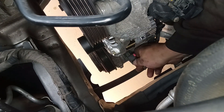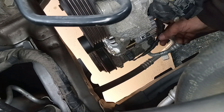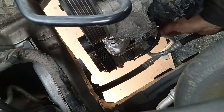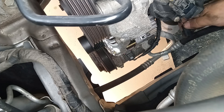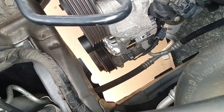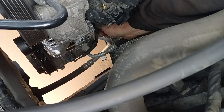Then we'll just put the belt back on. While I'm up here, why not put all the connectors on? Here's the AC one — put that on right quick, just like that, push that over. We have this little red one here for the alternator. It's kind of hard to get back on, but you've just got to slide it into its hole — just like that, there we go. Get that out from behind it. I dropped the nut — let me grab that. I've got the nut right here, and turn that so you guys can see what I'm doing. I can't see the front of the camera or anything really, so I've just got to feel for it.